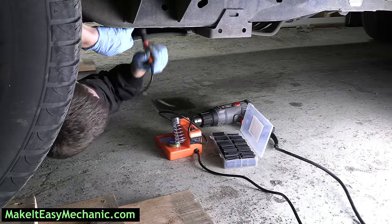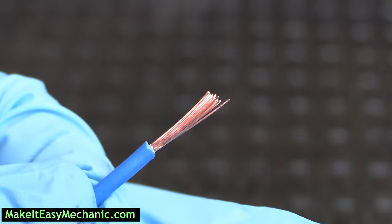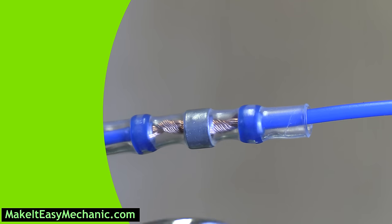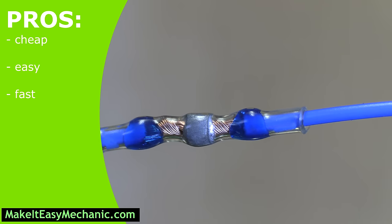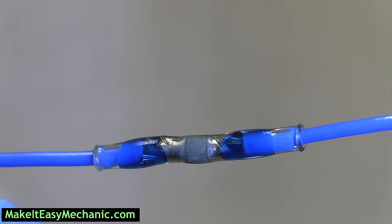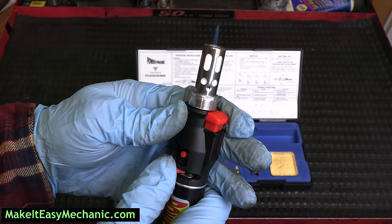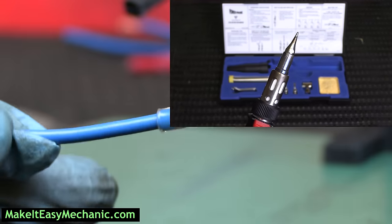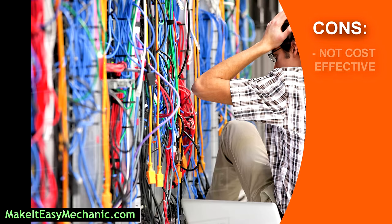The third and most favorite method: heat shrink self-solder connectors. Basic process: strip the insulation, slide the proper size connector on one side, interweave the wires, center the solder connector, and heat it up. In one step your wires are soldered, sealed and insulated. This method is cheap, easy and fast, creating a durable and waterproof connection with excellent conductivity. It can be used in marine, automotive and aviation industries. You could use a lighter to shrink it, but a heat gun or butane torch is recommended — especially a torch with a reflector tip to isolate the heat from the rest of the wires. It really gathers the best characteristics of both worlds. The only downside is if you have a hundred wires to fix it can get somewhat pricey.